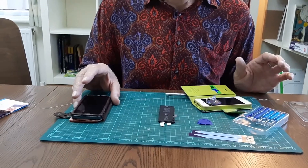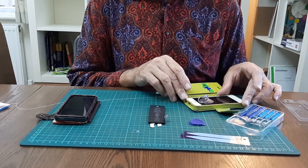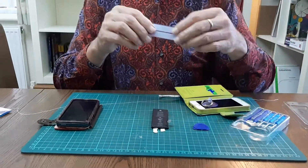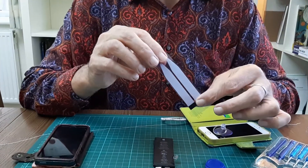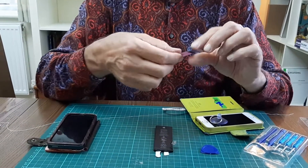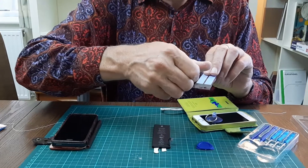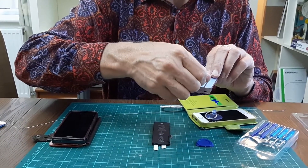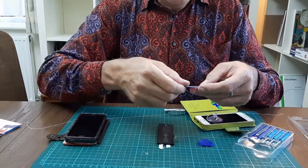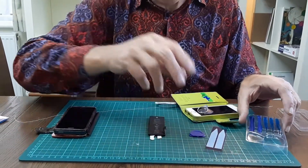With the iPhone 5, the battery was just resting inside. But with the iPhone SE, the battery is stuck inside using these command strips — double-sided adhesive strips. The idea is that when you want to remove them — you've probably seen them elsewhere — you simply pull the end, separate the two, and pull. It stretches amazingly, then rips out sideways and you should just be able to lift up the battery. Sure enough, that's what a lot of the videos show you.